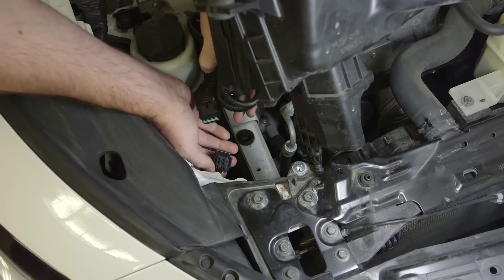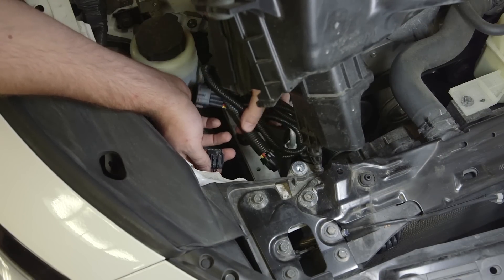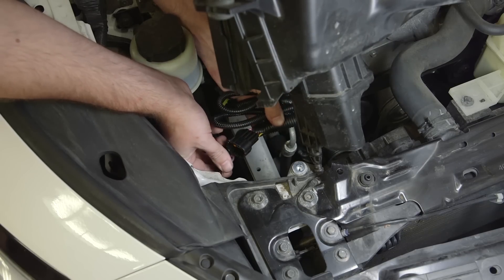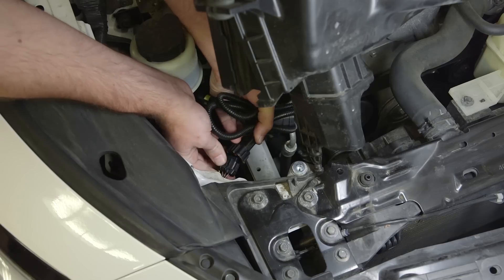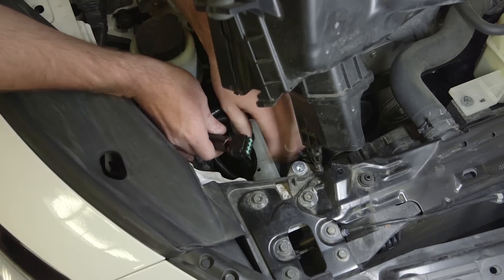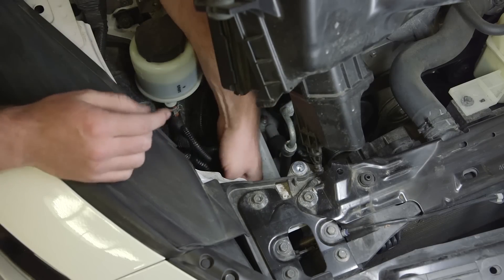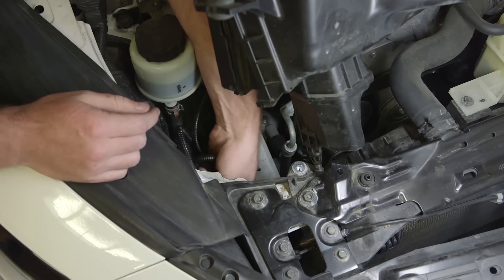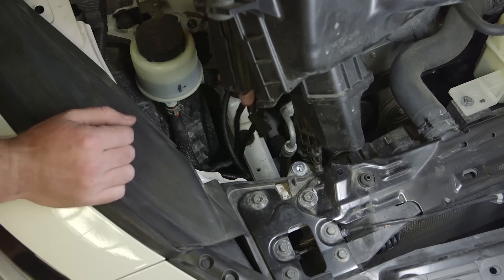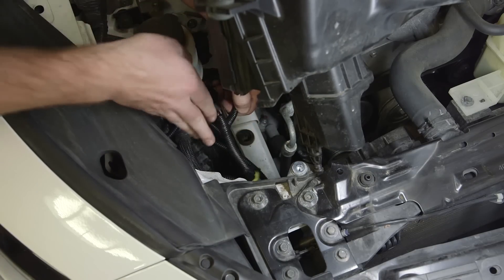Now we're coming from the front of the vehicle and we've got the headlight connector here. Grab your harness — you'll see that there are bigger connectors on it that are matching. We're going to plug one side into the headlight connector. It's just a straight-through connection, so clip that in with a nice tight clip. Then we're going to push this directly into the headlight — remember the clip goes on the bottom. Listen for that click. Then we're going to take the other side, which is our fog light connector, and just drop it straight down.